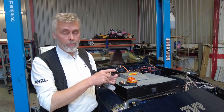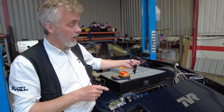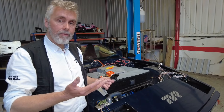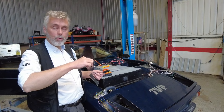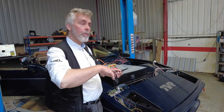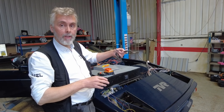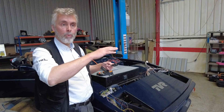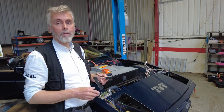These have also got a temperature sensor in them, so it measures the temperature of the air at the top of the battery box. That's another layer of safety. We're measuring the cell temperatures going through your Orion battery management system. We've also got an extra set of temperature sensors going into the vehicle control system — so even if we lose control with the Orion, we know if anything's overheating and we can make sure everything shuts down properly.